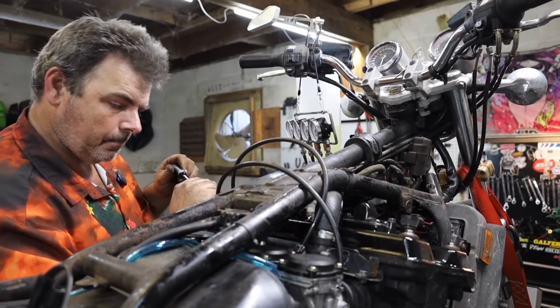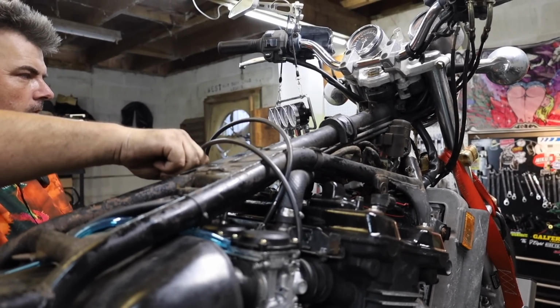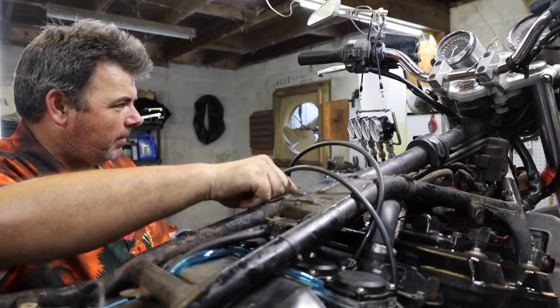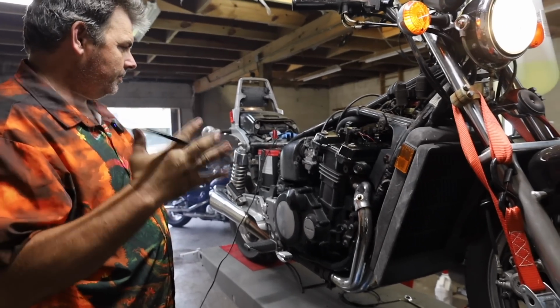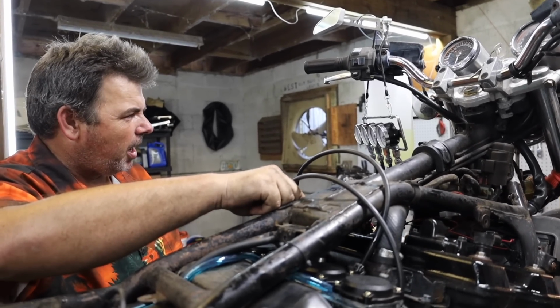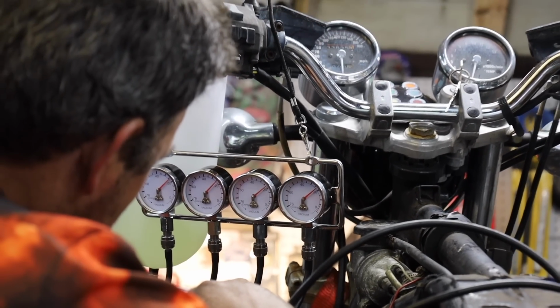And low compression has never been something to stop Joe the Mountain Jedi, and he was familiar enough with these engines to remember that they suffered from something called valve recession. A valve adjustment and a full carb rebuild later, along with some donated stick coils from a newer Kawasaki Ninja, and this thing was running just like a top.